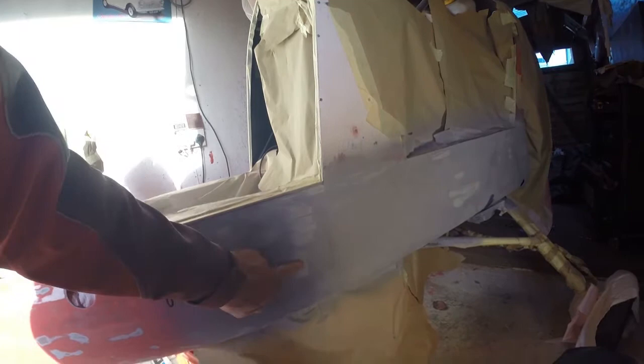Look, there's a big yellow thing in the sky - fantastic! So last night I put some etch primer along this side - not sure about the finish - and then I've put a bit of stopper on a few low spots that popped out, that were obvious. So I'm now going to flat a few runs in here because I tried to put it on as thick as I could. I'm going to flat that back now, let it dry out with the halogens on it, and then put another coat on this evening and try to build it up a bit more. Right, etch primer session two, flatted back.